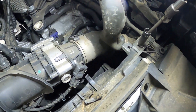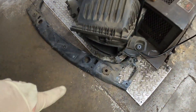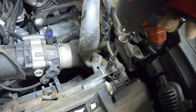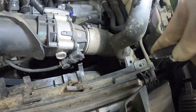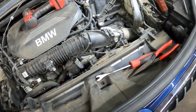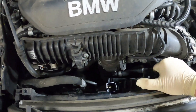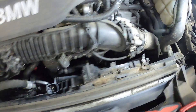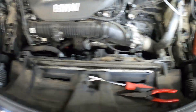I don't know why they designed it this way, but I think that's what holds the radiator to the upper radiator piece — the bolts go through here, so that's why they're so difficult to access. You've got to take those loose and then the fan should just slide out. Let me take a look and see if there's something else holding the fan in.